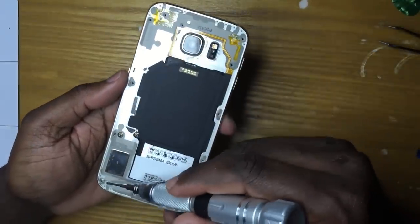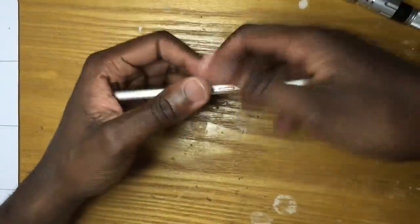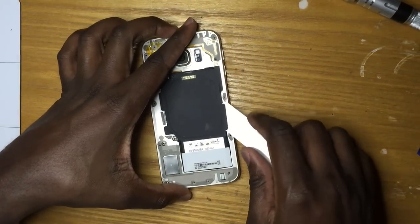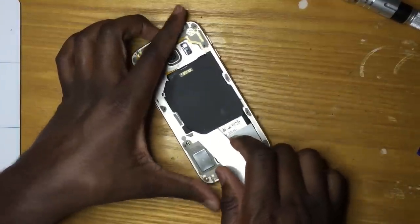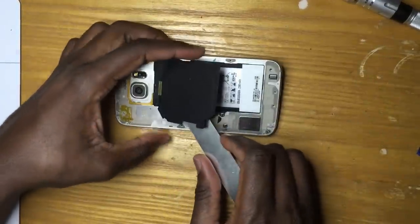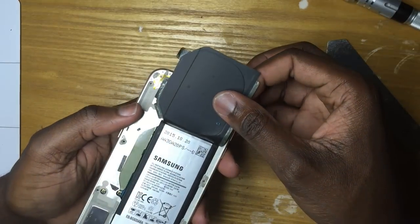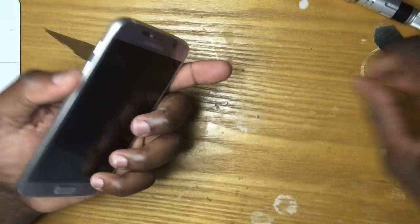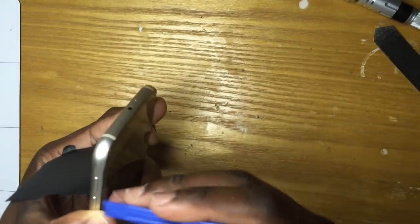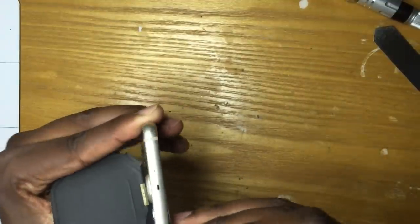I'm showing you guys where the screws are located. We just missed one screw that we are about to remove from the phone. This screw doesn't want to come off. So you're using your pry tool to separate this little black band on the back of the phone. You gently pry under the band and lift it up. You don't want to bend it too much because this black part is connected with flex cables. Next, you try to pull out the LCD attached to the frame, and since we have removed all the Phillips screws, they were retaining this front frame with the LCD.